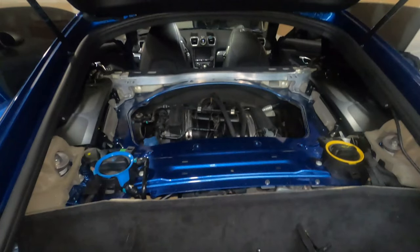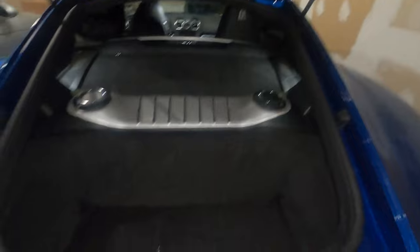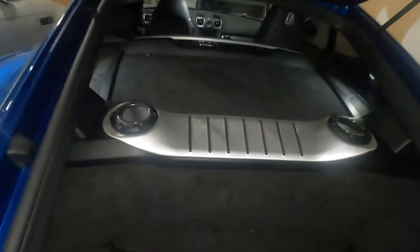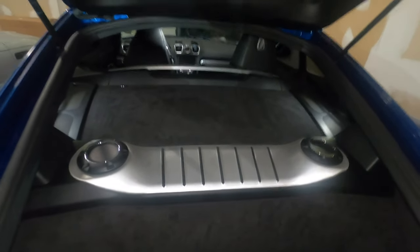To fix this, what I pretty much did is take all the vacuum lines provided by Soul Performance and install those instead of the factory lines on the Cayman. What happened is that the holes on the factory lines are actually a little too big for the input on the Soul Performance exhaust. So no matter what I was doing, because those are hard plastics, I still had a vacuum leak and that's why the actuators were not working. Once I replaced those with the Soul Performance vacuum lines, my issue got resolved. If you are installing a Soul Performance exhaust, I urge you to go ahead and install the provided vacuum lines with your PSE system. I hope this video was somewhat informative. If you like this video, make sure you leave a comment, like, and subscribe. I'll see you on the next video — bye-bye.